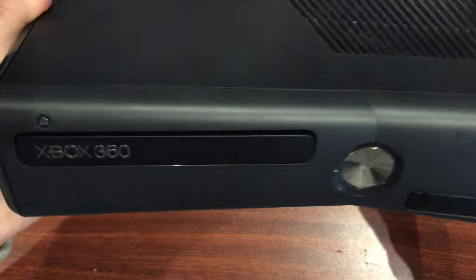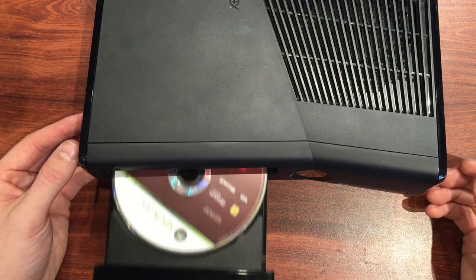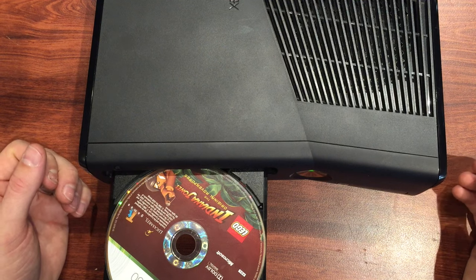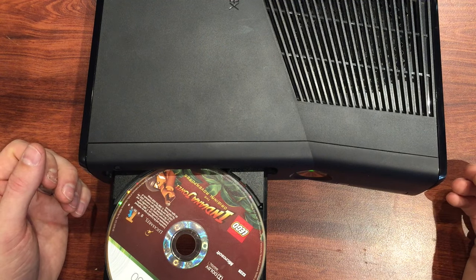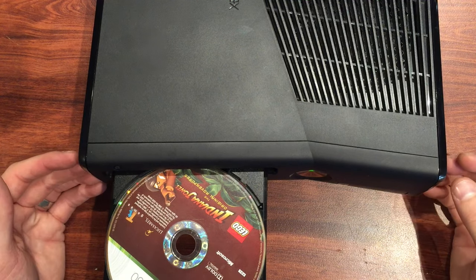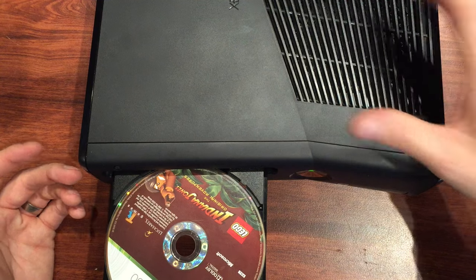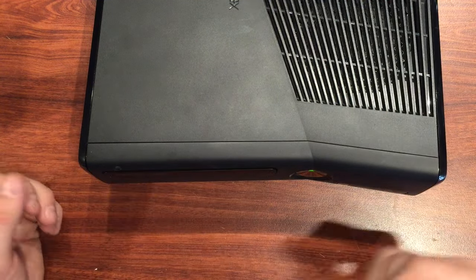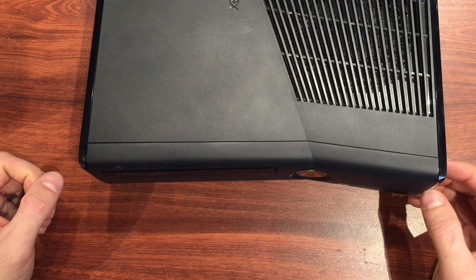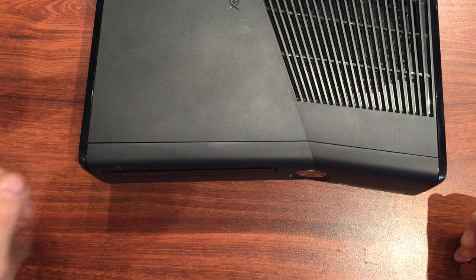And we're all back together — everything looks pretty square. Let's plug it in and see what happens. Let's just pop it open again. Yeah, it's pretty smooth. At the start of this video I didn't really demonstrate it jamming, but I'm sure yours is. Just follow this whole process on how to pull that apart and realign your tray — I think that's all you need to do. I just wanted to pull it apart anyway and have a look, make sure it was sitting correctly, have a look at the laser, give it a clean, and check out the internals. Hope that's somewhat helpful for you and you get your Xbox 360 Slim running again. As always guys, I'll aim to post up another video again here soon. Thanks for watching. See you next time.